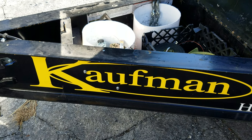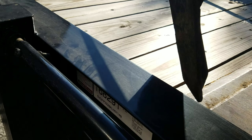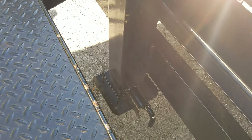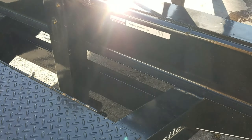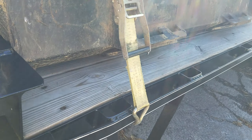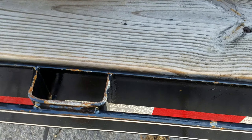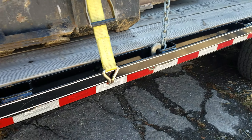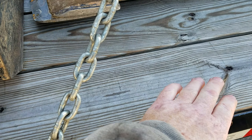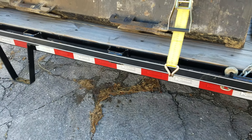It's got nice big 10-inch I-beams. I just opted for the single jack — it's a little awkward to crawl in there to get to it, and it cranks pretty slow. It would have been nice to have two-speed. Nice rub rails. This trailer can be got in the 14,000 or 16,000-pound version. When you get the 16,000-pound, you can see the cross members are 16 or 17 inches on center, where on the lighter version I think they were two feet.